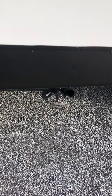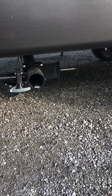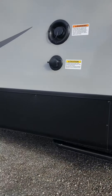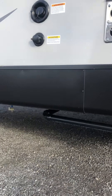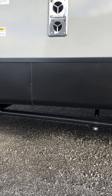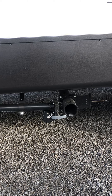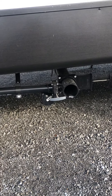For dumping the sewer, take the cap off like it is now, pull the gate valve in the back, open the black handles for the toilet, pull and dump it. Then hook a hose up over here — that's the black tank flush — and that'll clean the sewer system out. Pull the black gate valve, dump it, hook a hose up to the flush, let it run for a couple minutes, shut the hose off, close the black valve, and you're done flushing.